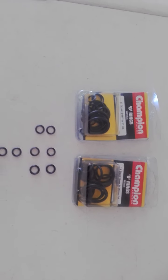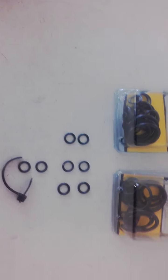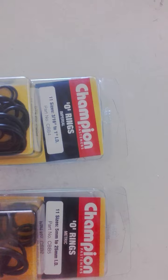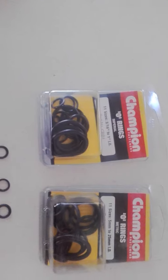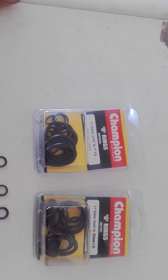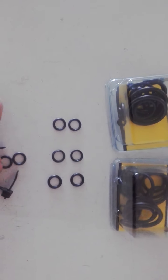Alright, so we're looking at the o-rings now. This set here in the middle at the top — that's what came out of it, they're kind of crushed. This came in the kit with the rack; I didn't realize it was included. I've got a set of o-rings on the left — imperial — and on the right, metric. It does appear that these racks are in fact imperial. I couldn't remember, so I got a couple of packets. It does look like they're supplied with the rack, which is great. For anyone else who needs to know the o-ring size, it looks like they're definitely imperial — 5/16ths on the inner and I think around 7/16ths on the outer, but don't quote me on that.